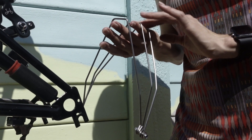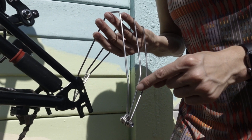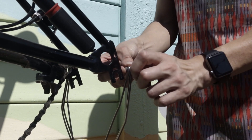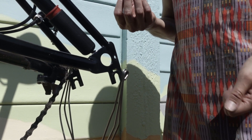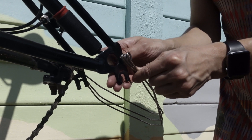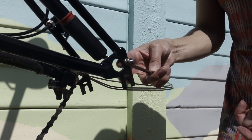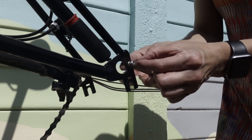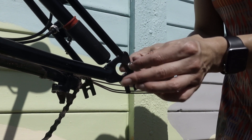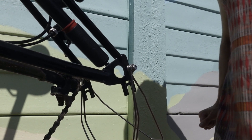The stays come in short, medium, and long. The short one goes on the inside and should fit towards the front of the bicycle. The medium one comes next, then the long one. These get fixed to the rear axle plate. The bolt and washer go on the inside of the axle plate, and on the outside you have the second washer followed by the nylon nut. We're just going to do these finger tight for now.